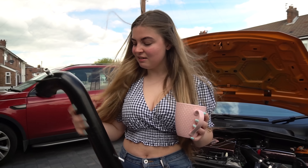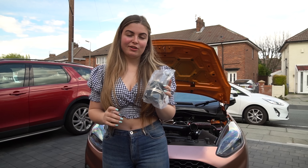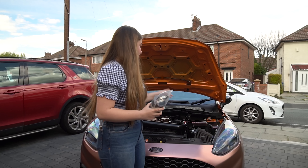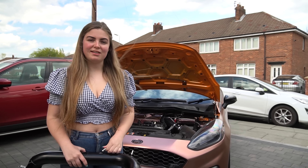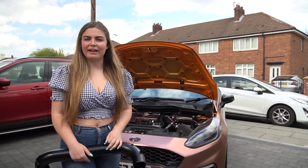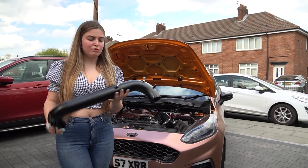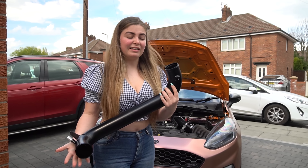I'll show you what comes in the box and just get into it — I'm excited, let's fit it. In the box we've got a silicone hose which goes on to the turbo end of the crossover, and then this end goes on to the intake. The standard crossover has dents in places making the diameter smaller and more restrictive, whereas this Airtec one is all smooth, same diameter all the way through, and obviously less restrictive.